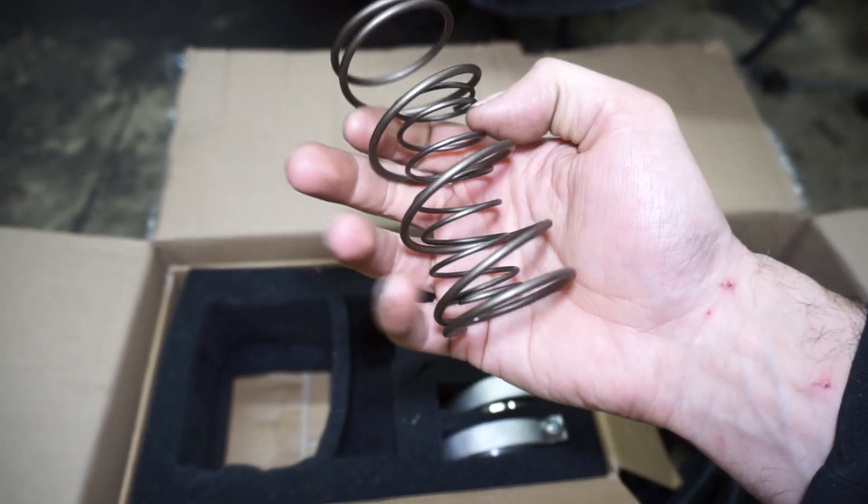That was the more challenging part I was worried about — getting those to fit properly, notching them, and getting them to look halfway decent. Next is going to be the flanges as a template. I can use the flange, mark ballpark where the hole is going to be, take the turbos off, drill it — and those will be real simple: just 90 down, straight piece, 90 out. We'll make that the next video — finish the down pipes and the cold side. I also got the tubing for the oil drains: two different thicknesses. The big one will be for the drains and the smaller one to remake that little standoff spacer inside because that bolt down there doesn't have one.